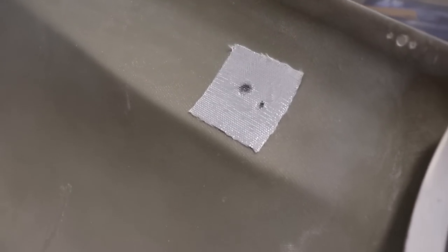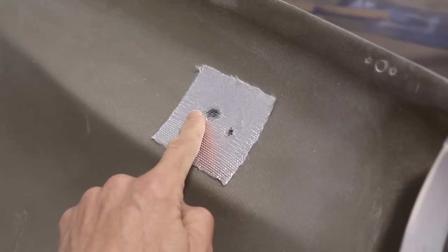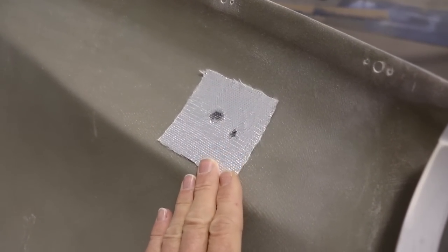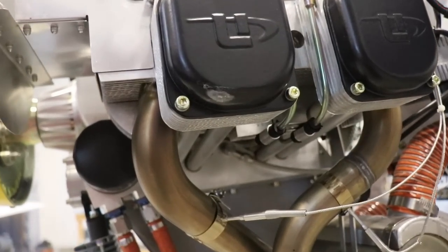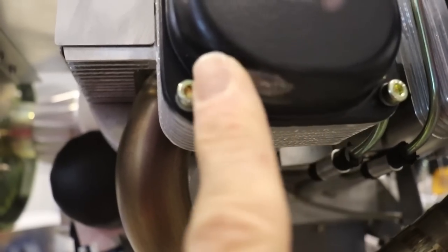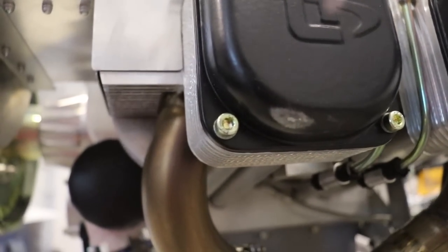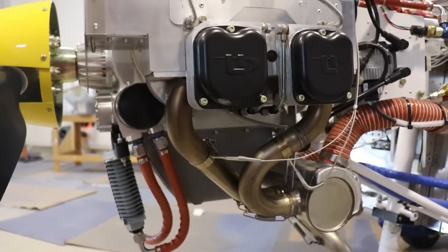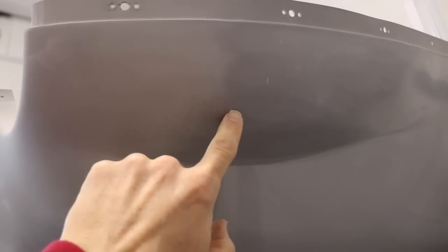I have another issue I need to address before I can paint the cowl. I noticed my valve cover for the cylinder was rubbing on the cowling, so I put a stick-on heat shield there thinking it would cushion that, but it didn't. The cover is aluminum and you can tell it's already taken off the coating — it hasn't done damage to the cover itself but it is wearing on the coating. I think I'll have to cut out an opening to give that cylinder some room, then fiberglass some sort of slightly domed cover there to give it breathing room, hopefully in a way that doesn't look stupid.